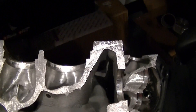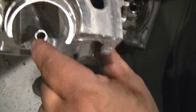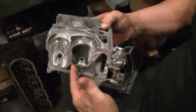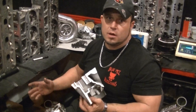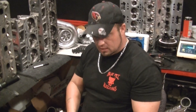You'll see a lot of videos out there that talk about messing with the swirl ramp. If you don't notice where that's at — that's right in the swirl ramp where people are telling you to take it off. Be really careful, because typically if you don't pop through it, you're paper thin right there. You overheat your car once and you pop a hole right there, fill your cylinder up with water — all kinds of bad stuff. Don't mess with the swirl ramp just to gain an extra three horsepower and lose all that torque. Heads are expensive, don't do it.